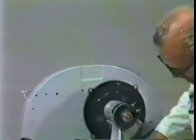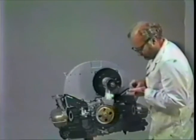Use them. I don't like to see them because the washer that they have trapped within them is a slightly different thickness and outside diameter than the washer that we normally use loosely, the loose washers that fit over the 6mm bolts. Consequently, at the Concours, I usually take a point or a quarter point off for every one of those I see, but like I said, this is not a Concours engine. For one, it's CAD 2 plated, not CAD 1. And most judges, to be honest, at the Concours won't know the difference, but I do.